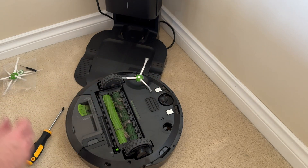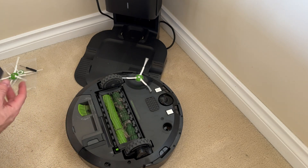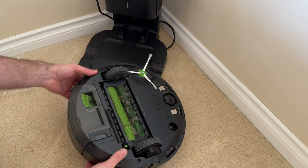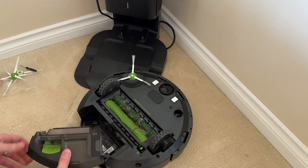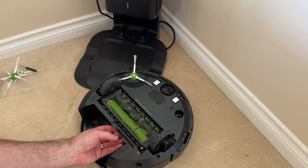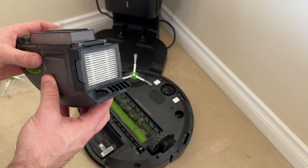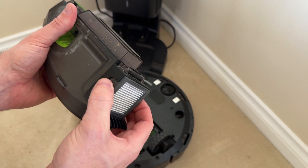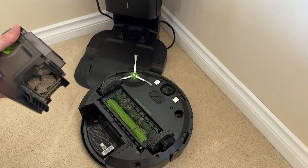The next thing we're going to replace is the bin filter. If you look at this bin filter you'll see it has the no-water sign on it. There is a button right here — you press that button and it releases the bin. It's a good opportunity to clean it out; if you've got pet hair in here, stuff will get in there. Your filter is right here — these are relatively easy to pop out, you just squeeze and pull it out. You'll see this one is very dirty, so it's definitely time to replace it. I'm going to clean out this bin before I put it back together.